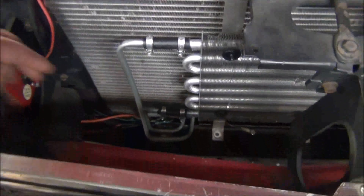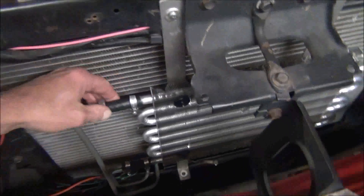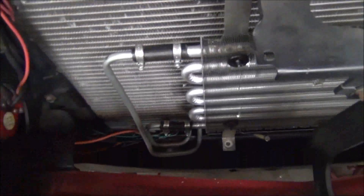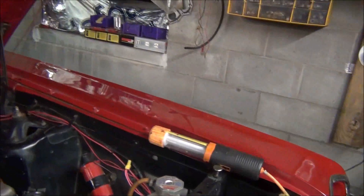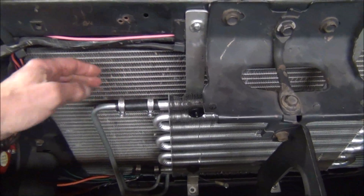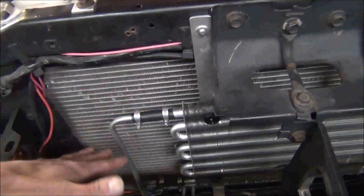I kind of like the way this part turned out. I used my Summit flaring tool — I've already put it away — but it works really nice. I need to make a video on using it because it does a really good job. The only rubber connection I got is on these rubber lines here, and I'm kind of happy with the way that turned out. It really cleaned things up. I moved the cooler away from the radiator, because it's a lot easier to get your lines on. And if you want to remove the radiator, you don't have to fool with that — it just stays where it's at.